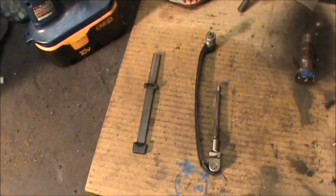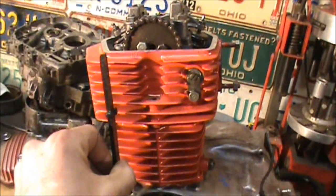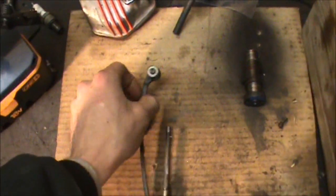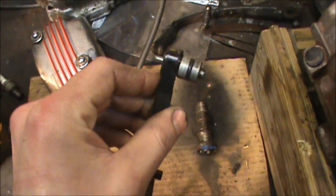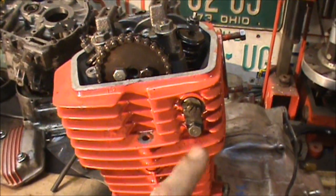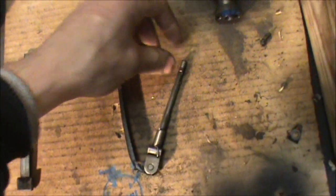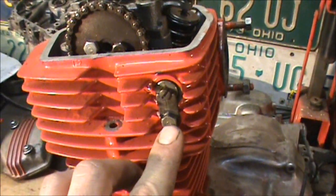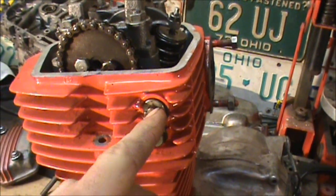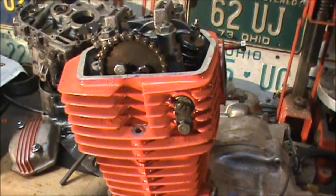Now you can't really see in there, so I've actually got some of the chain guides and an adjuster right here. This little flat one will be in here on this side to ride that side of the chain. And this little screw here is what you have right here, and this works as a little locking mechanism. You see this rod here — it's spring loaded. So if you loosen up this 10mm here, you can rotate this, and what this will do is push the tensioner closer to the chain to reduce the chatter.